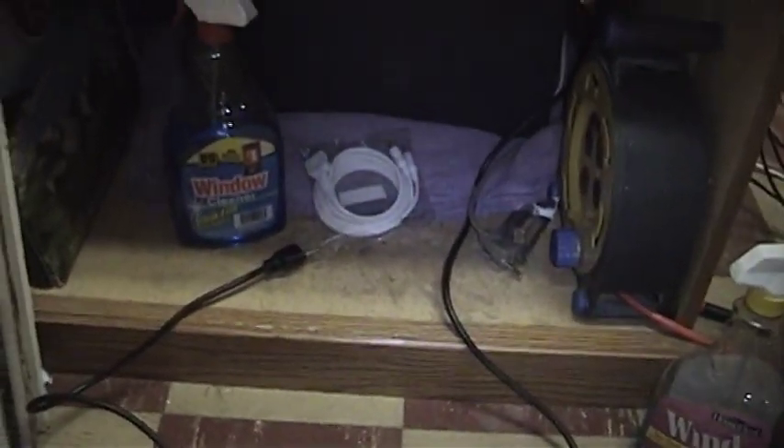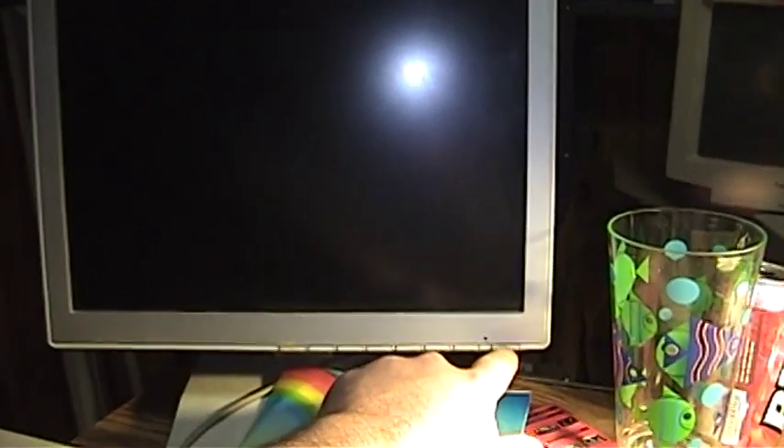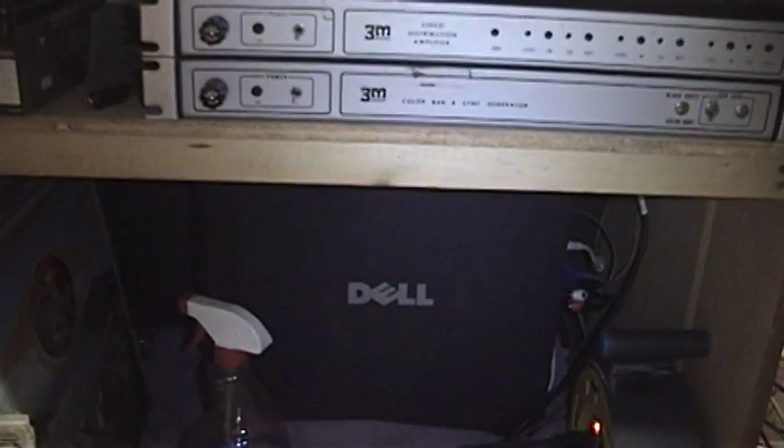In fact, before I left, I actually pulled the power cords out so that nothing could happen. And I unplugged the display too, though I didn't have to — but that's being paranoid for you. So let's see if this thing's still dead since the time I left. Go ahead and turn that back on. The flat panel display's got power — that's good. Let's see if the computer does anything. I don't think it will, though. Yep, still just deader than a hammer. So it's time to haul it out of there and pop the cover. I think it's the power supply that's quit, but we'll just have to see.